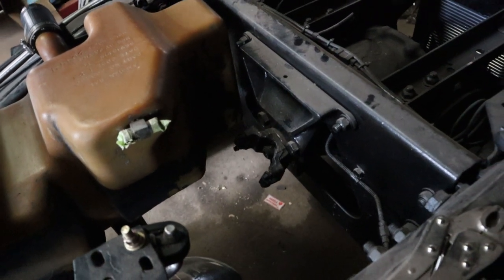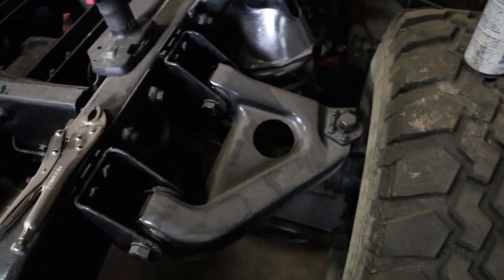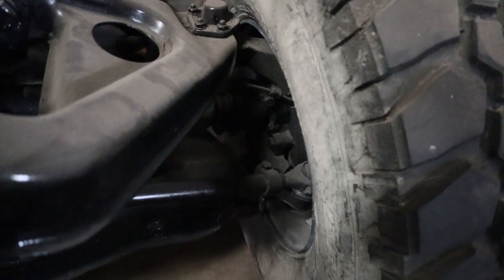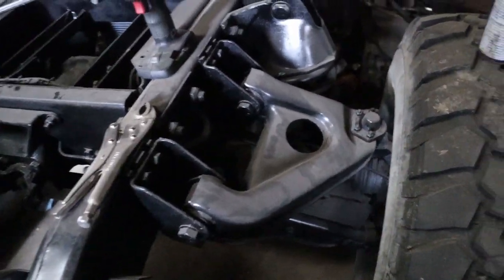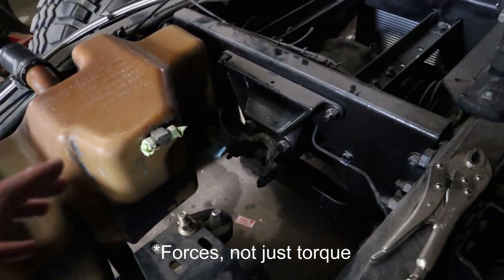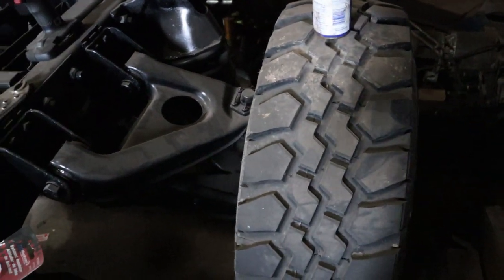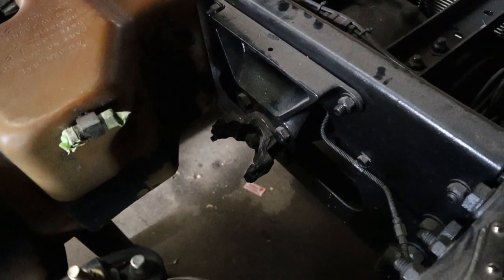I don't think there will be quite as many issues given that our rear diff is a solid mount, our front diff is a solid mount, everything's solid mount, and we have our independent control arms on the side. Also inside our wheel well we do have the hubs with a two-to-one reduction. That reduction in the wheels may actually help reduce how much torque is applied directly to our u-joints compared to what's needed to move these big tires.